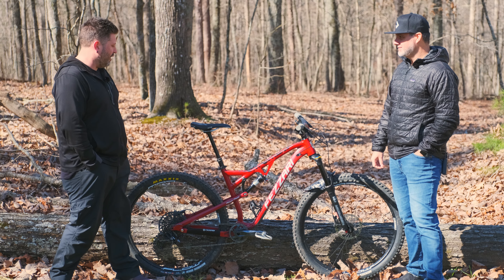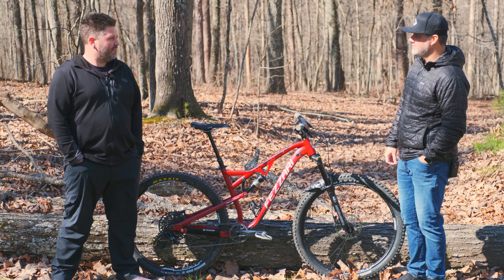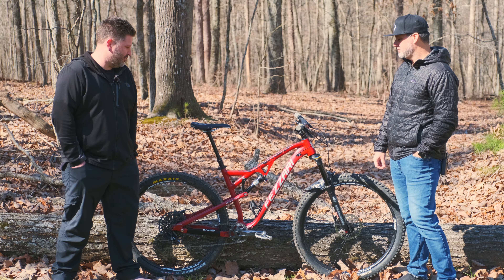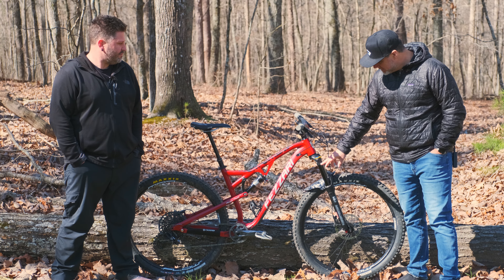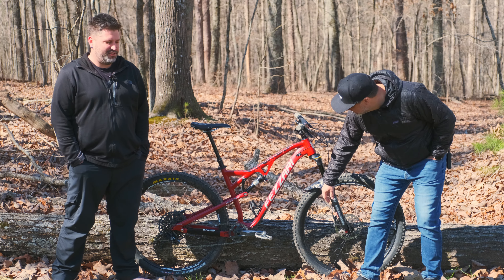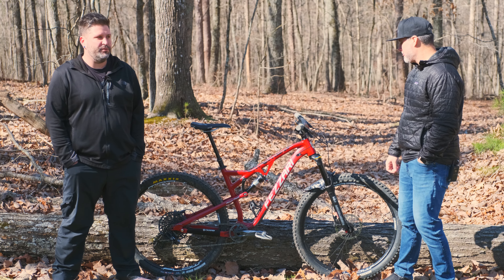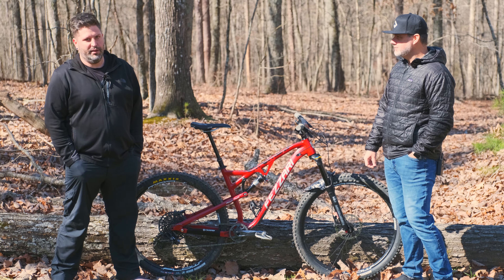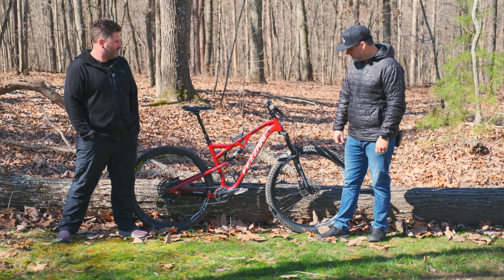There's really no supple off-the-top feel, and there's no way to get that with this suspension because you can't throw spacers in these to change the progressivity. So you're having to make up for that with spring rate and air pressure, which makes for an incredibly harsh ride. And I still think you're bottoming a little bit. The o-rings are riding all the way up to the steer — this one's all the way off. Even with all that air pressure, he's still not able to get the stroke in a happy place for his riding style, weight, and frame design.